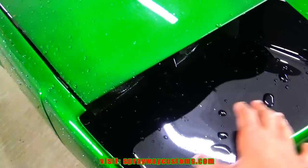On all my videos, I like to show different ways of doing stuff. And I think I'm just going to use my rotary, mainly, for its buffiness. Besides up in here, I'm going to use the DA, my smaller Bigfoot, because it can get up in here a lot better than the rotary. And plus, it's been a while since I painted it, so the paint is good and cured and hard, so I don't really have to worry about burning through.